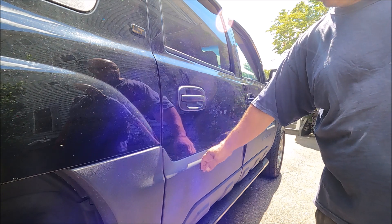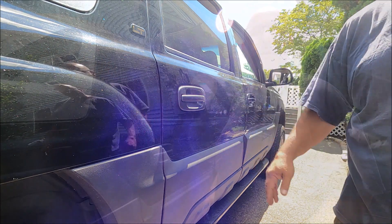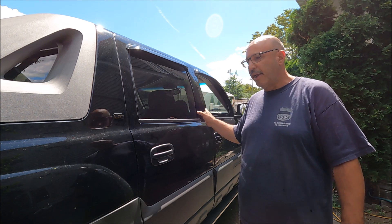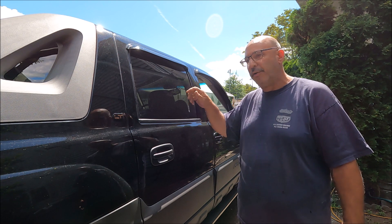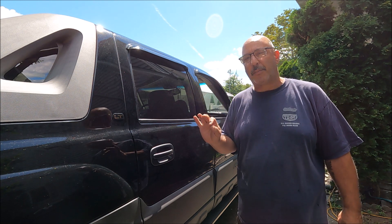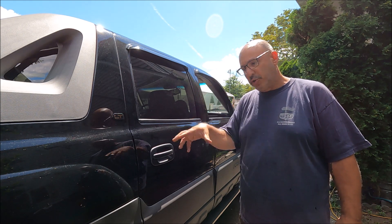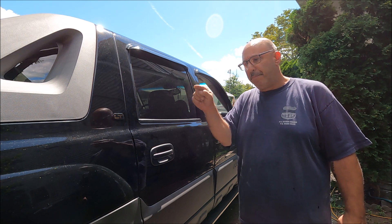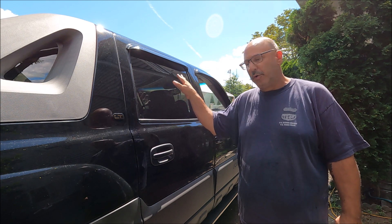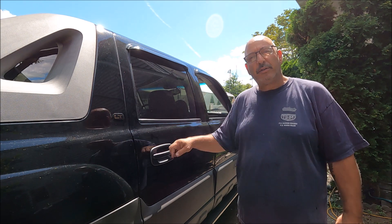They sort of match the texture of the bottom panel, especially once these start to fade and get a little coating on them. Good enough. That's it — real simple. In reality it'll probably take 10 minutes to do both rear handles. Front handles are a little bit different because they have an adjustment point for the key lock, especially if you just have the key lock on the driver's side. Passenger side we're going to do in a separate video, because we're also putting in new door switches, new speakers, new door handles, and new seat memory switches on the driver's side. I'll link everything we use in the description below, and as always, thanks for watching. See you next time.